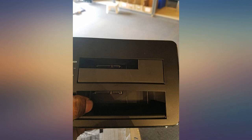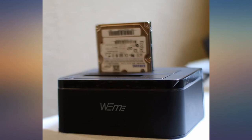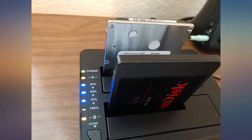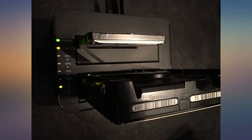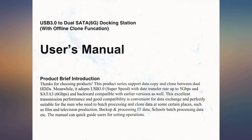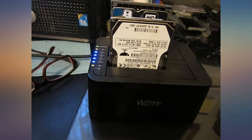Cloned a 500GB 5400 RPM SATA I to a 500GB SATA 3 SSD. I used the clone feature built into the docking station and it cloned the 500GB drive to a new SSD 500GB drive with no problems the first time. It took about an hour and 20 minutes or so for the 500GB to clone.